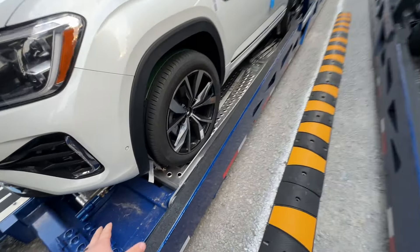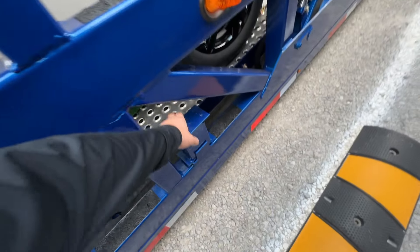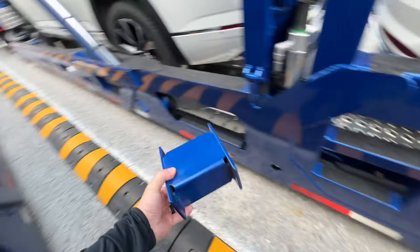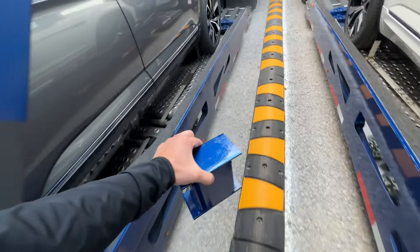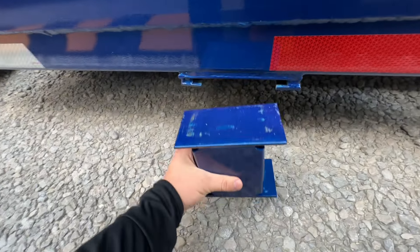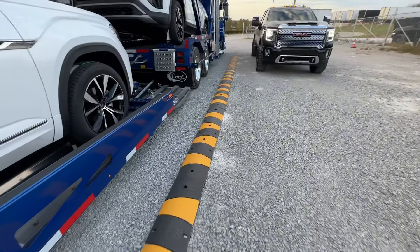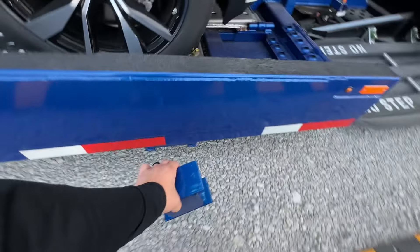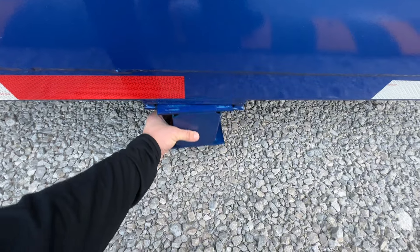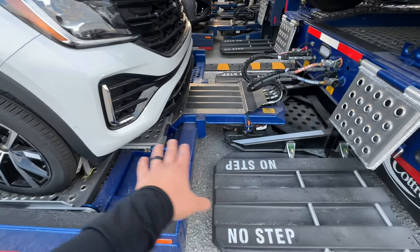So I guess we'll do a quick tutorial on how to unhook a car hauler trailer. We have these blocks over here on both sides — we're going to need these. Take them out; they're already scraped up because we already used them once. They go right into here and this little slot, just like that, on both sides. Let's put this other side in. Now we're going to go in here and deflate the airbag so that it can sit down on those blocks.